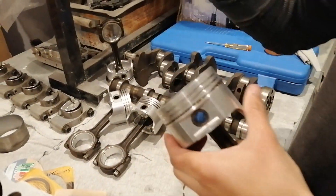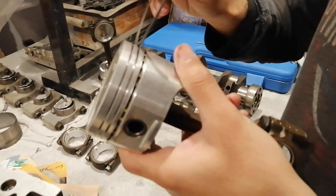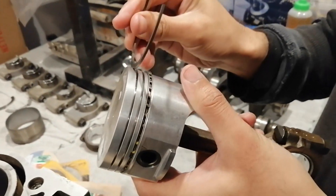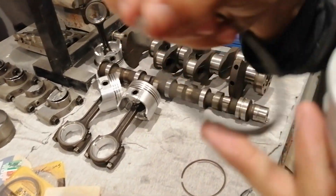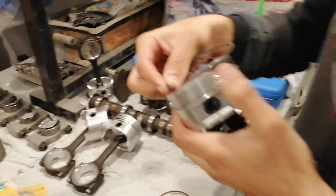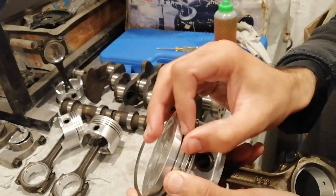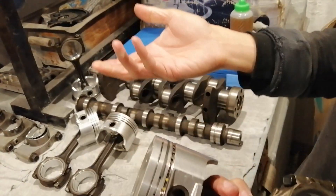This is the compression ring. If you don't know which is the compression ring, look at the groove on the piston. This ring fits in this groove and this ring does not fit in the other groove — that means each ring goes to its specific groove. The marking is written on top of the ring. Install the ring with the marking facing up, placed into its correct groove.